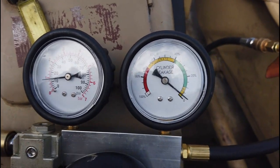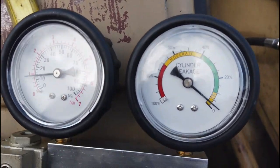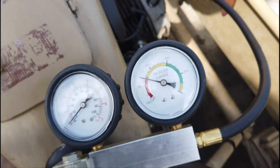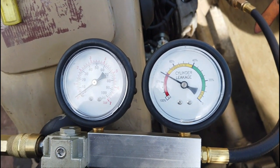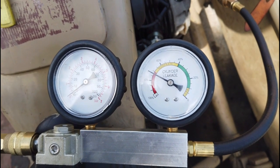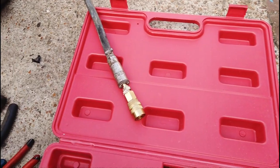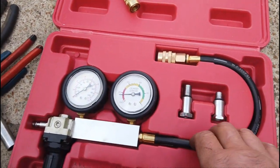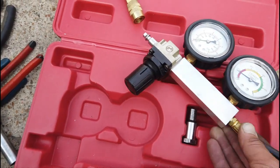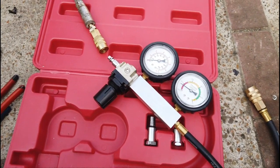Another way of checking is to slowly turn the engine over until you get one of the valves slightly open — then you can hear it starting to hiss, which indicates a leak. You can see it starting to move, and in a moment it'll go right around to the red, which tells you this is a really leaking system. That's all it is — it's as easy as that. I hope you enjoyed this video.